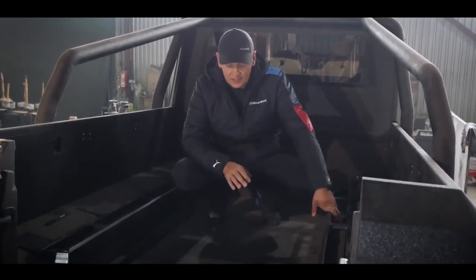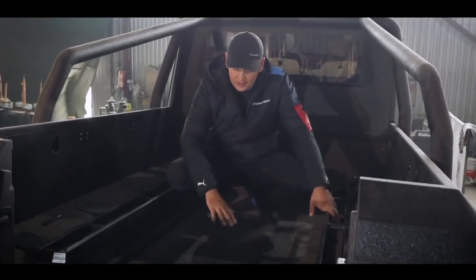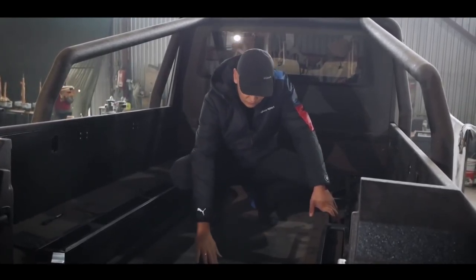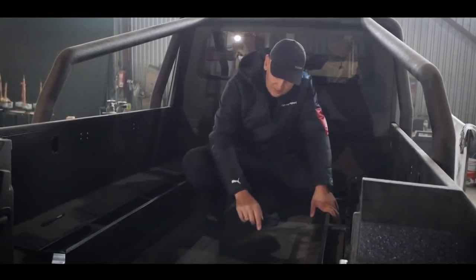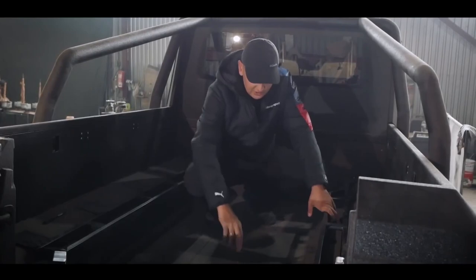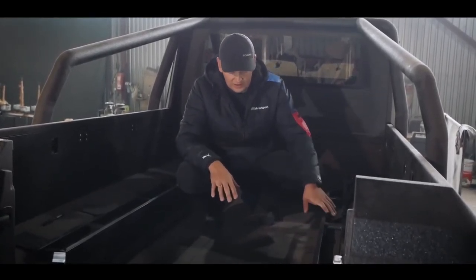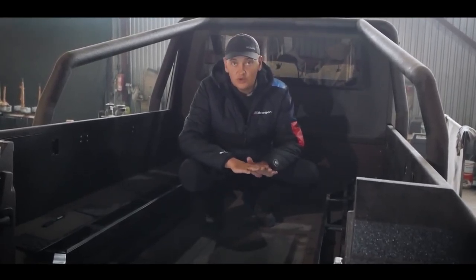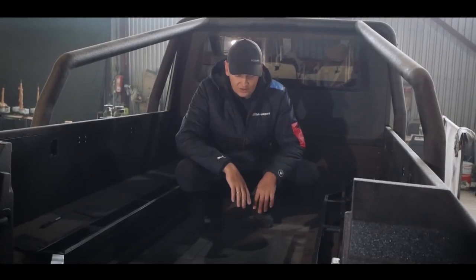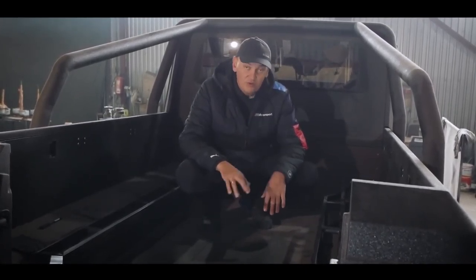And while we were making holes in the body, we put here two layers of sealant, so when the plank is pressed, like now, the sealant will be flattened, so the holes will be full of it. So even if there is some moisture, it won't get into the holes, so there won't be any rust. I suppose it's not bad. The plank isn't scared by sunshine or rain or snow.